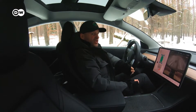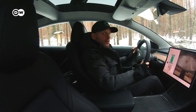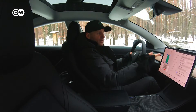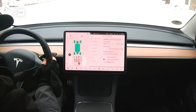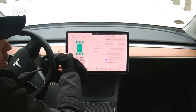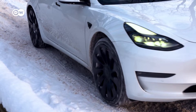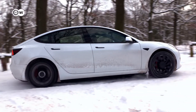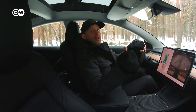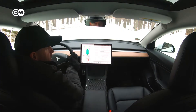So that means it's all-wheel drive — it's not 100% to the front. That means it's not a front-wheel drive. So now we do it to 50-50, let's see what happens. The rear tires are spinning more. So that means it is already transferring power to the rear and a little bit to the front. 100% to the rear.